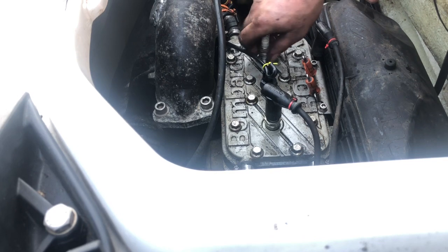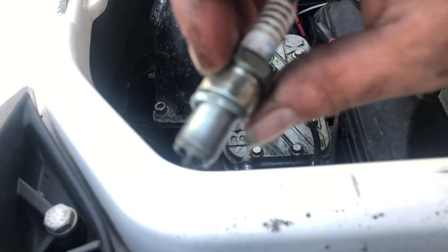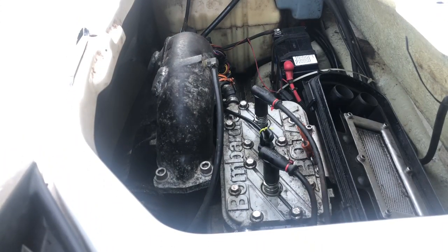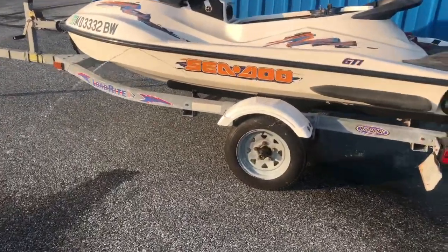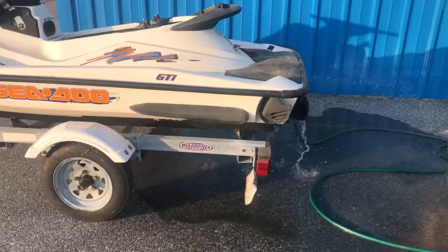So we'll have to get her running. Yep, plugs are oil fouled, so let me clean them. Okay guys, I think I finally got this squared away where she should start. I had to keep cleaning the plugs because the crank is full of oil, as you guys seen in the carb kit. She's running now. Let's go ahead and finish putting this back together and we can run around. I'll see you next time.